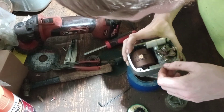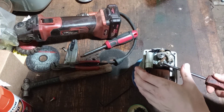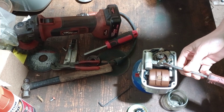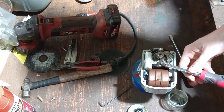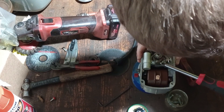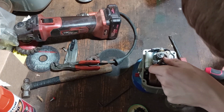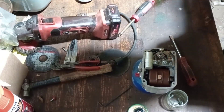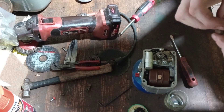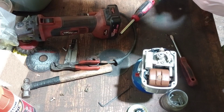The points are slightly corroded. That oiling felt doesn't look that great. What I'm going to do is replace that with another one that I have that I bought for the other mag, because that oiling felt looks kind of nasty. I realize it's a new old stock oiling felt, but still. This one that I have here is also new old stock and it looks better.